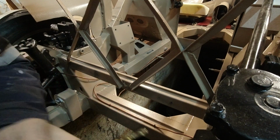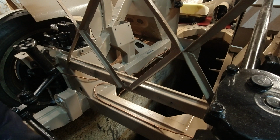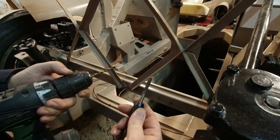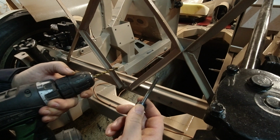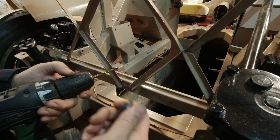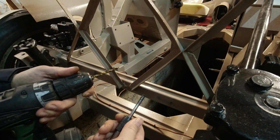Next, the right size drill bit. Let's talk about that. What is the right size drill bit? We're going to tap threads into it with this. There's a very specific size drill you need to drill the hole out, so this will have enough to cut, but not so much that it breaks. So I looked it up, there's a chart, of course, and it's 5.5 millimeter.